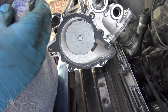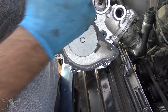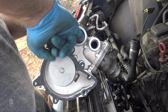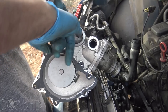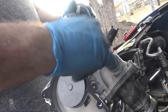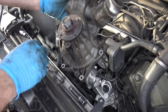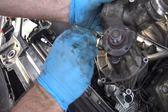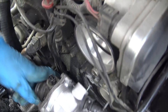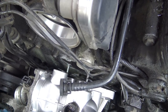This is dielectric grease, which is also called silicone paste, and that lubricates O-rings. It's rubber-safe lubricant — you definitely want to lubricate O-rings because they will just slip right on if you do that. If you don't do it, you're struggling with them. So we didn't talk about where the bolts go — these long bolts go here and here, the short bolts go everywhere else. You can see there are these two alignment dowels sticking out from the engine, and that's where those long bolts went.